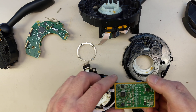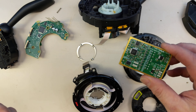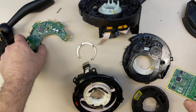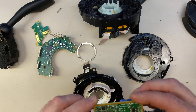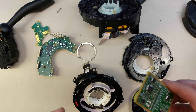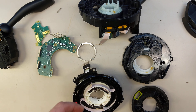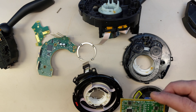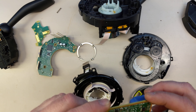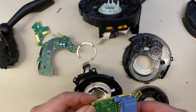This is the little slave module which will be found up in the steering wheel, which interfaces the steering wheel controls — on the Tesla those are the two scroll wheels. It encodes it as LIN, and then sends it through the clock spring to this one, which puts it on the CAN bus. The steering wheel controls just have three buttons on each side and a little infrared optical encoder to sense as you spin the scroll wheel up and down. There are also some LEDs in there that light up. This drives the LEDs — looks like a low side driver that turns on the LEDs, the LIN transceiver, and then just a connector.